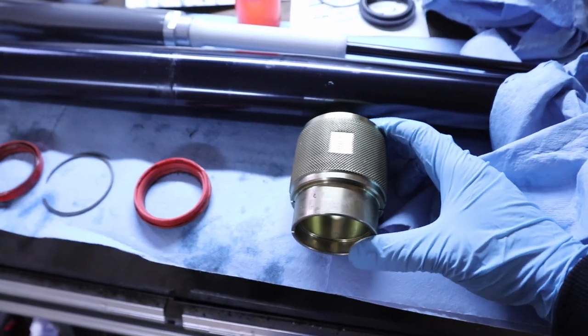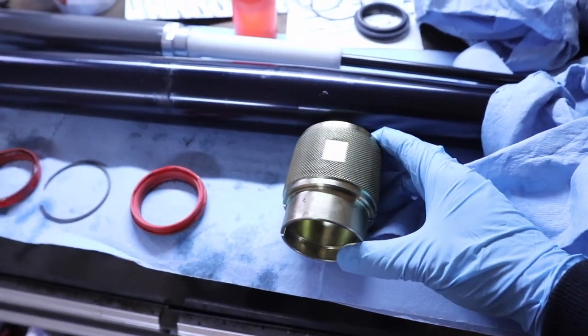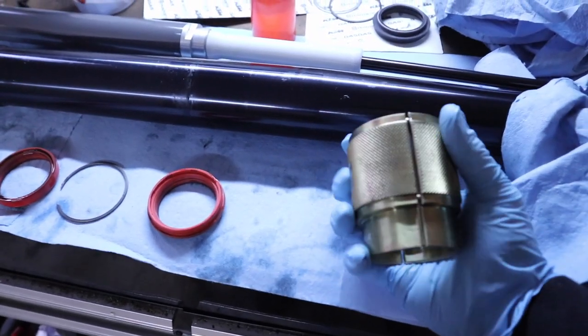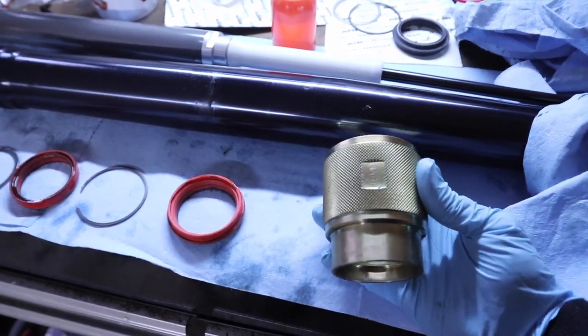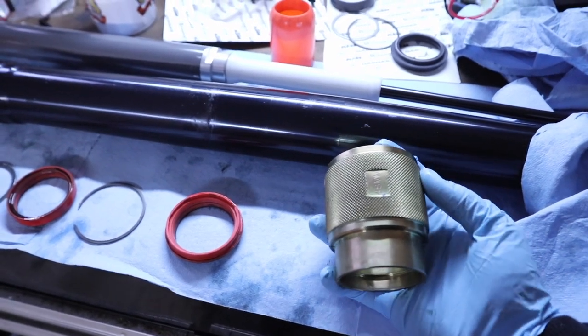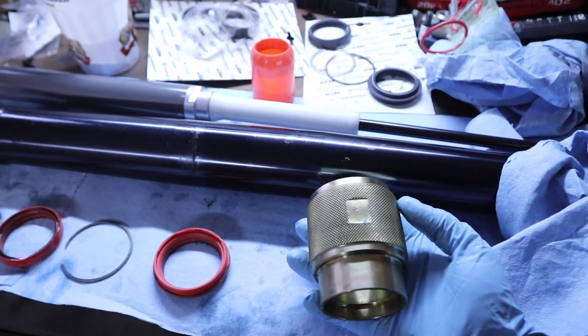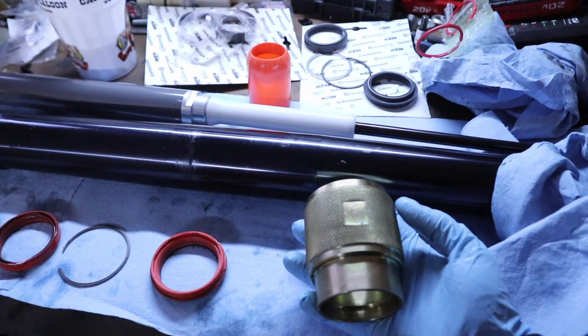Okay, so in order to get this fork back together, we're gonna need a seal driver. This is one made by Tusk. This is a specific size for this fork. It's 48mm. I'll link that down in the description below, but there are other ways to do it, but this is the easiest way and the best way.